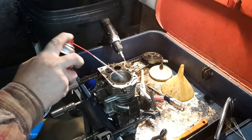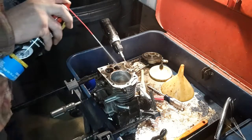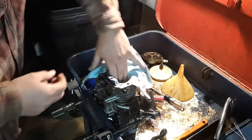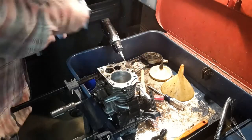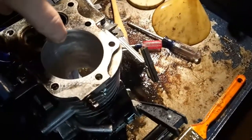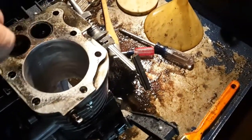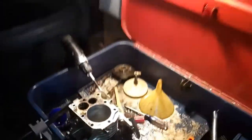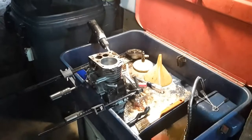Get a little brake parts cleaner here. Take a rag and run down through it. Take this up here and let you see down in it. If you notice, there's a little spot right there that it didn't get. The rest of it looks pretty decent — a couple little scores right there. So I'm going to go ahead and run it back in there a little bit longer and see what we come up with.